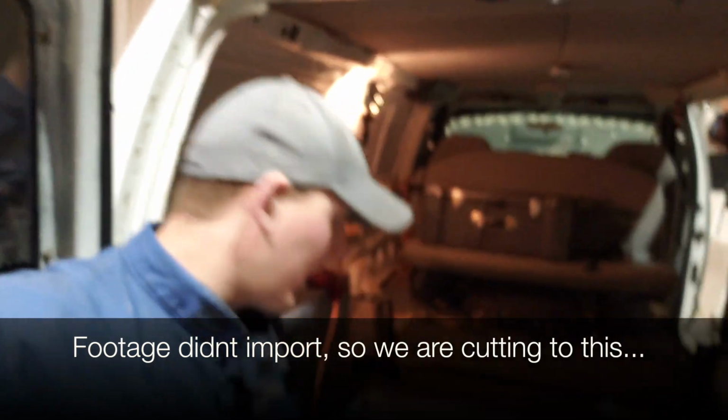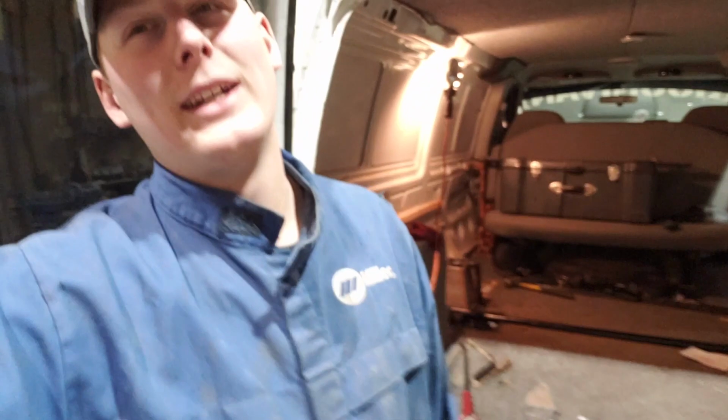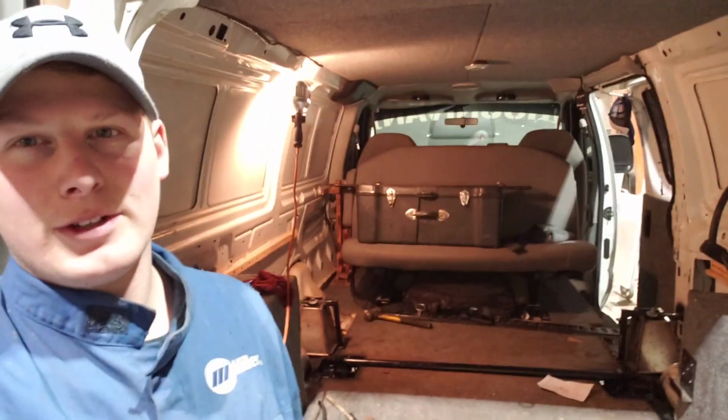So I just got the stainless steel coil buckets welded up with my mild steel MIG welder, and it worked pretty good. I mean, the weld's gonna rust out before the stainless steel ever will, because the stainless steel isn't gonna rust, but the mild MIG wire will. So I'm gonna have to coat it in a bunch of paint, cross my fingers, and see if it'll last for the next 10 years. But it turned out pretty good.